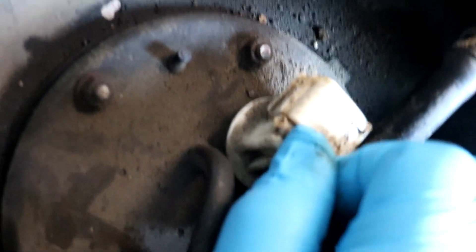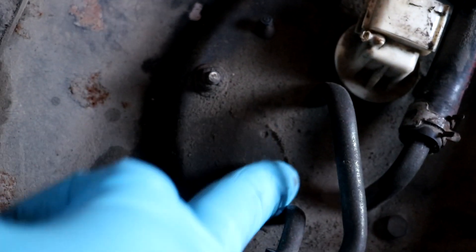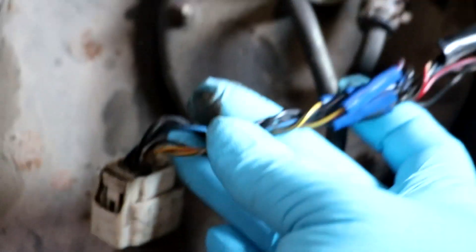The back of the connector at the butt head starts to melt also. So what we will do is look for some space here on the hanger and drill a hole, and see if we can get the two wires for the fuel pump to come out of there separately — then wire directly to the fuel pump wires.